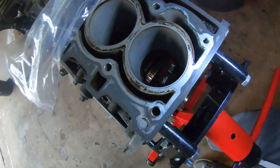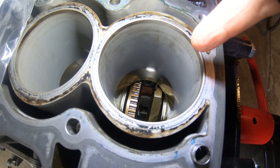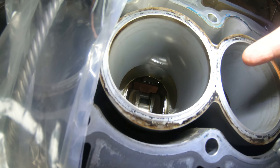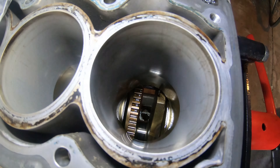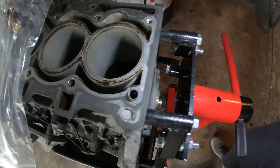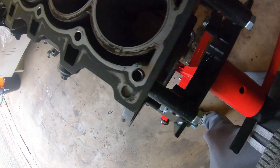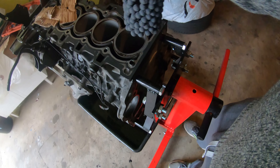We'll clean it out after. You want to be very careful when honing the block to not hit the crank or the little nozzles that cool the pistons — they're down there on the left. So I'm going to shove some cardboard down in here so that when I'm honing it doesn't hit those pieces, because we don't want to damage the crank. As you can see, the end of this does have a pretty sharp little tip to it. Okay, so we've got our cardboard down there protecting our crankshaft, and I've got the hone out.